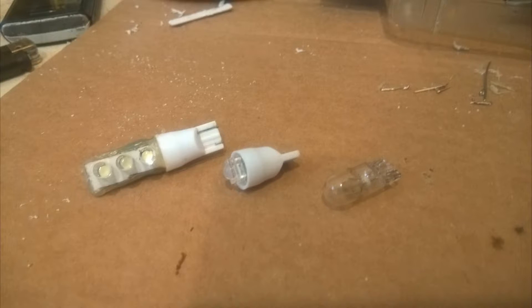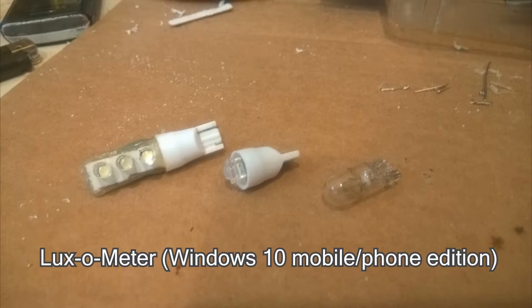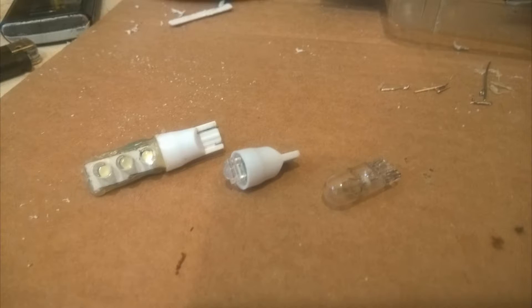Wait till darkness, after which I went on a really dark street and tested it out. It gives a bit more light than the existing LED that I had. I measured it with a luxometer phone app. The single LED bulb gave off about 10 lux and my custom bulb gave off about 20 lux. It's only a slight improvement. Oh well, what can you do? If you want to see more of these tutorials, or maybe you want to hear my silky smooth voice, or you just want to hear more of my really sarcastic jokes, make sure to subscribe.